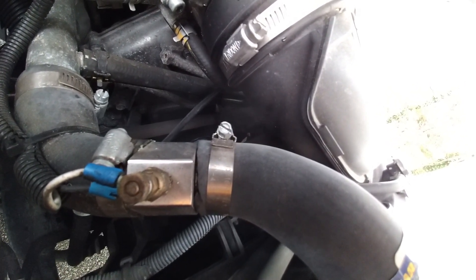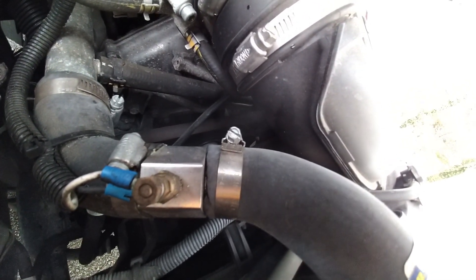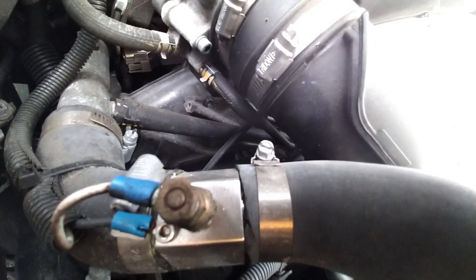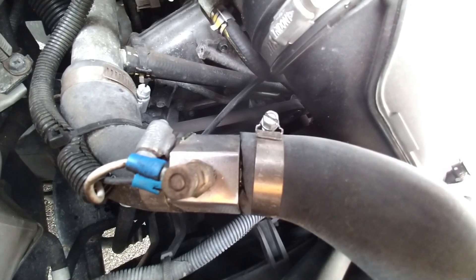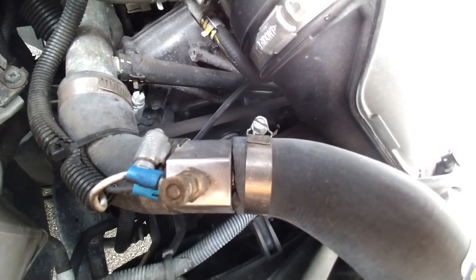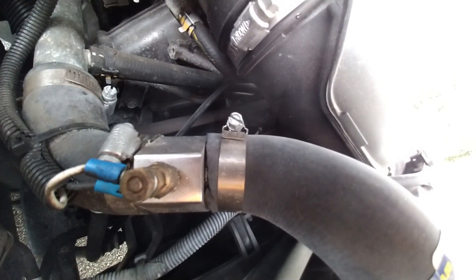You throw the clamps away and get yourself some Ideal stainless steel hose clamps — that's actually the name of the company, Ideal. You go ahead and cut a section out of your upper radiator hose, mount that in, and make sure that you do not forget your ground cable. If you notice here, there are actually two wires coming out of this sensor, and that is extremely important because without that ground lead, you will not get any signal at all. How the gauge is actually working is it's sending a small current through this wire, which then transmits through the sensor and out through the ground wire back to the chassis of the truck. As the temperature varies, the sensor is changing its resistance, which changes the amount of current flow. Without that ground lead, you have no current flow at all. Therefore, your gauge will be completely non-functional, and you'll be scratching your head in frustration because nothing is happening.